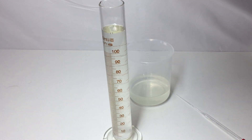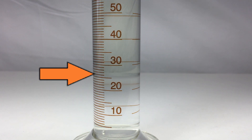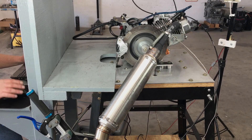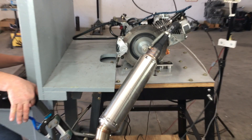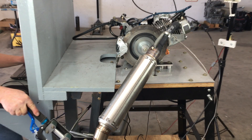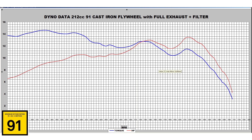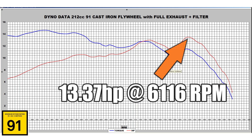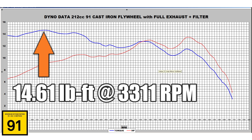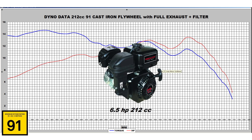We mix the sample and check how much ethanol is in the 91 octane fuel — looks like we're at 6% again. Testing 91 octane with 6% ethanol, looks like we lost some power and only managed 13.37 horsepower at 6,116 RPM, and 14.61 lb-ft of torque at 3,311 RPM. This is within the margin of error, or possibly this simple industrial engine just can't take advantage of the higher octane. This one's too close to call.